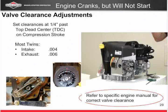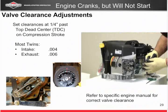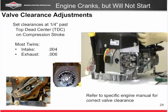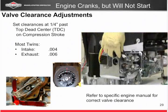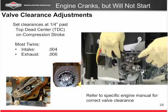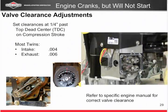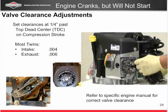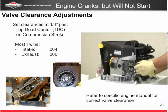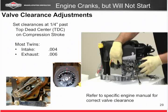Refer to your specific engine manual to make sure you get those correct readings, especially if you're going between Briggs, Kohler, and other engines. Then get your feeler gauge. Sometimes you can get down to three or four thousandths of an inch. In this one, we're going to do the intake first, so I'm going to set it at four thousandths. I take and go in the back between the valve and the rocker — this one's a little bit on the loose side; I could probably put a six or eight thousandths in there, so I have to tighten this up a little bit. I take my wrench, loosen the lock nut, then I've got an Allen wrench that I put in, and I turn this in a little bit, then take my feeler gauge and put it in between the valve and the keeper, turning until I get a nice snug feel.